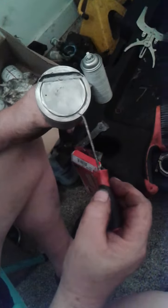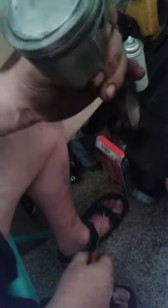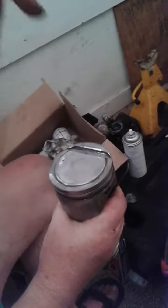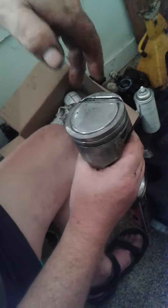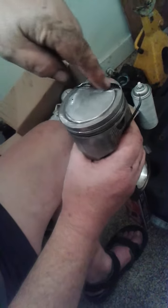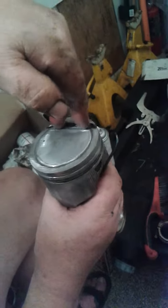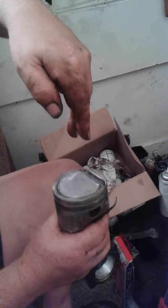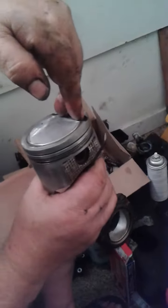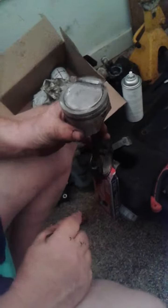This particular engine is what they call an interference engine, because the valves interfere with the stroke of the piston. The piston goes up and down, and the valves open — this engine actually has four valves but I'll just demonstrate two — either one at a time or two at a time depending on the configuration; this one happens to be two at a time. The valves that connect through the cylinder head to the cylinder are closed when the piston comes all the way up. If the valves go out of time with the piston, they will be open when the piston comes up and will hit the piston. That's why it's called an interference engine, as against a non-interference engine where regardless of valve position, the piston will always clear the valves.